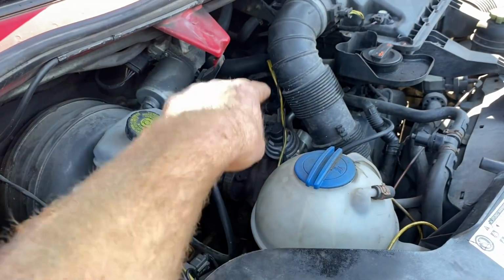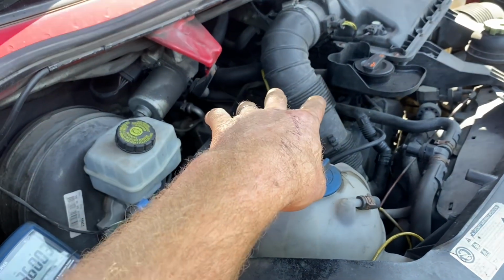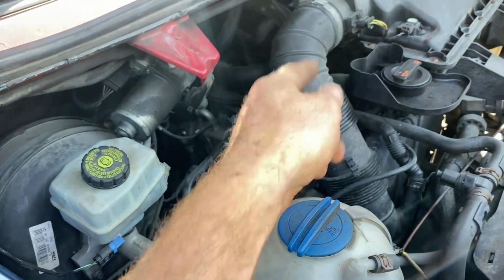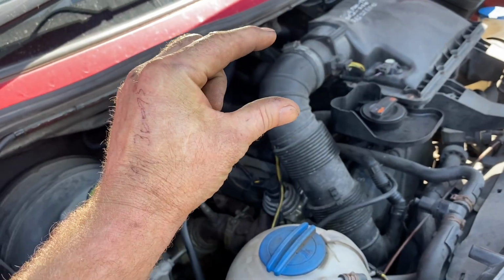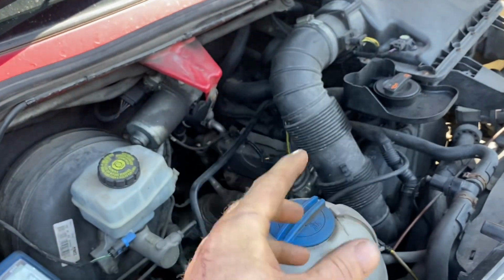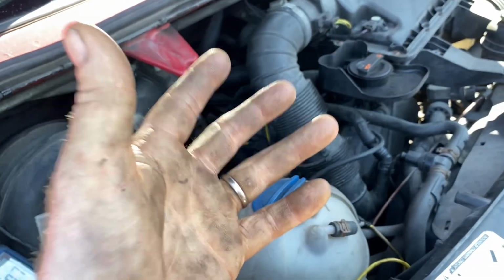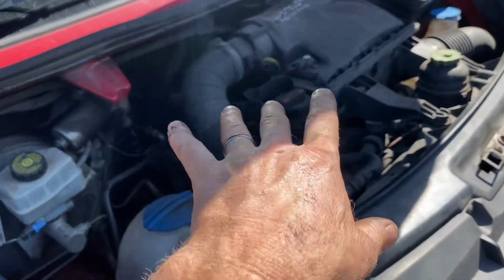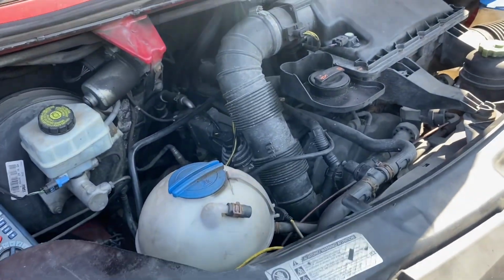If I disconnect the actual block connector, I'd like to see this being a pull down circuitry. So the signal wire is going to be 5 volts, we're thinking maybe getting pulled down to 0.75. If I disconnect it and I see 5 volts down there, it's proving the wire from my engine ECU is intact, and if it doesn't, then I go digging a bit.